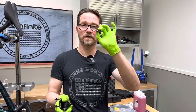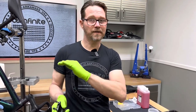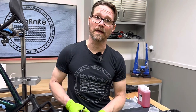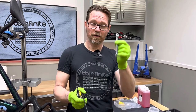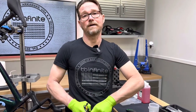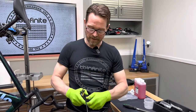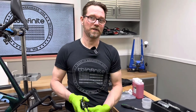The first thing you do anytime you're going to mess with the brakes, exposing brake fluid — brake fluid is going to be anywhere. Take the pads out. We're going to go ahead and put a bleed block in here. We will be doing a bleed video after we're done showing you how to do this. I'm going to go ahead and remove the line right now, and then blow it out and get it nice and clear, because the next step is the money shot.